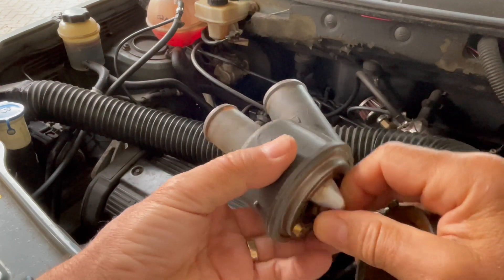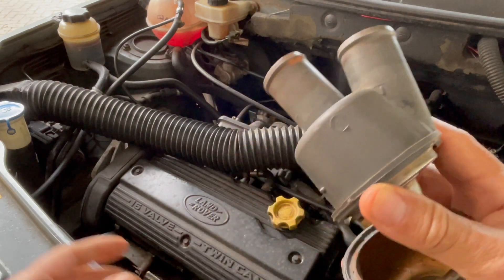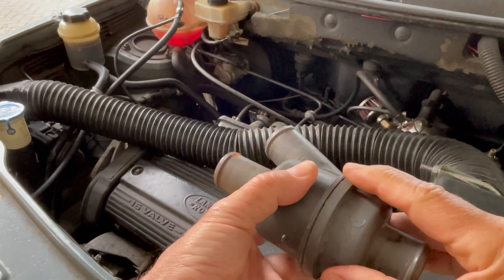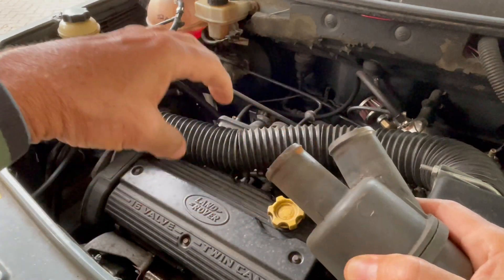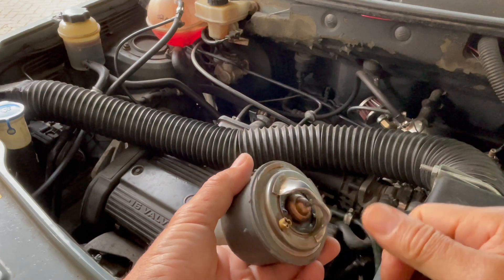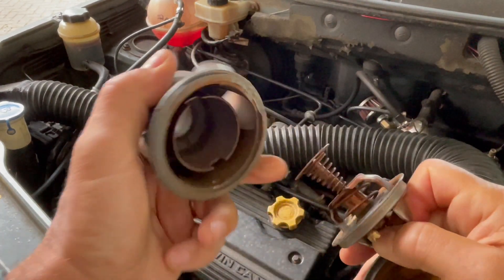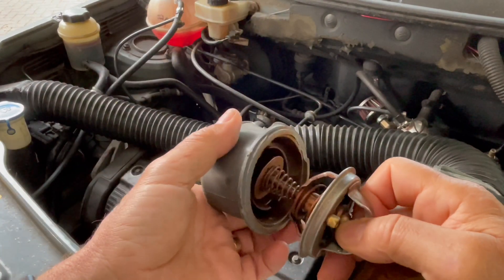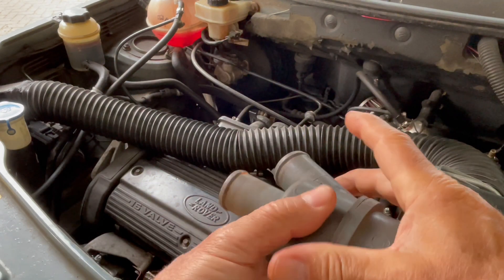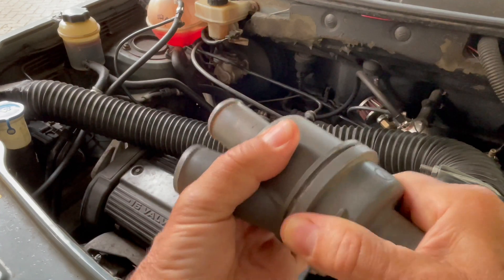The engine gets hotter and hotter — I've seen it go all the way up to 117 degrees centigrade. The fans start going like mad because the temperature sensor says the water's too hot. Unfortunately that makes it even worse, because it just cools down the PRT thermostat even more and makes the radiator even cooler. So the thermostat remains shut and the engine overheats until you blip the throttle, which creates more flow — you then get a lot of hot water going over the thermostat, it suddenly opens, and you get a gush of cold water rushing through the radiator straight into the engine. The engine rapidly cools down, which is not good for the engine, head, or head gasket.